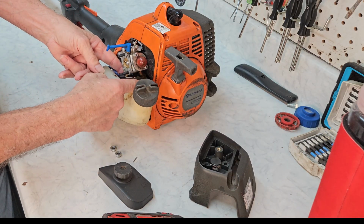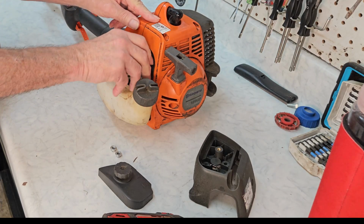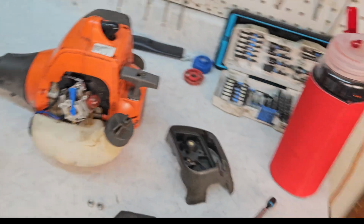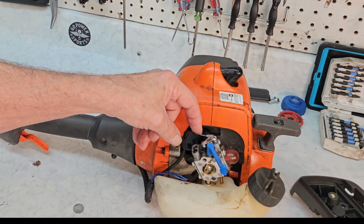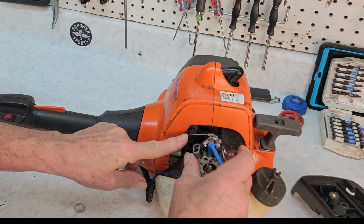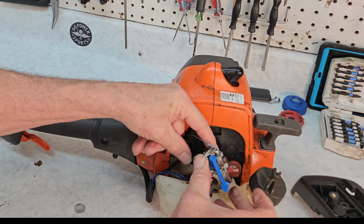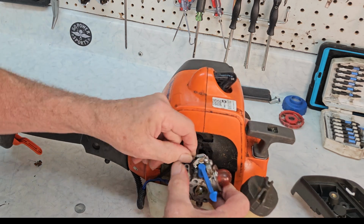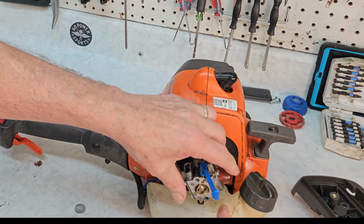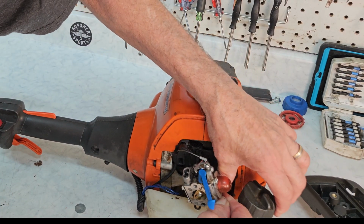And this is it. We'll take a look at the fuel lines. Fuel lines don't look terrible on this one. Let's pull her out. You got this little backing plate. You got this little guide here. So you want to make sure you pull it around the guide when you're pulling it out. And fuel lines are still holding this. So you got the cap loose. Even if you're almost out of gas, loosen the cap. The gas will feed back through your fuel lines.